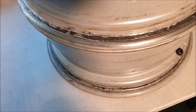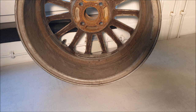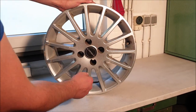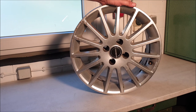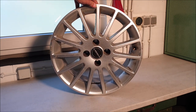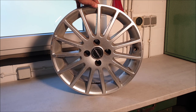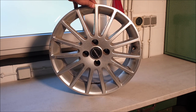So it's not worth it if you want to get some cheap alloy wheels for your car. Another thing where you can see a wheel might have damage is if it has a lot of weights like this one — they put 50 grams inside this one. This tells you the wheel itself is not turning very well and that they had to balance it to the limit. Classical curb stone scratches like this one, or not well stored — you can see more curb stone contacts. This is not that difficult to repair; you can see it in one of my other videos where I repair a set of these. The wheel I showed you before with the damage in the round will be repaired by a professional company, and after I get it back I will fully restore this set of wheels.